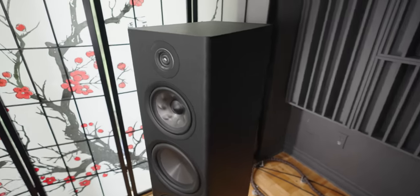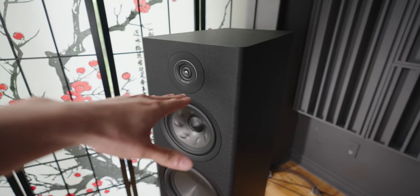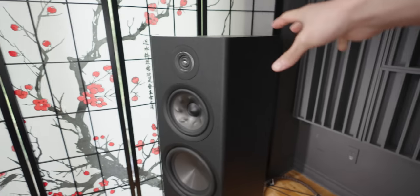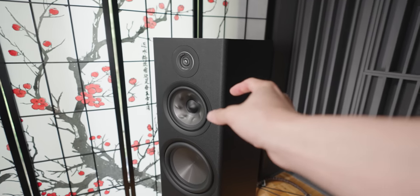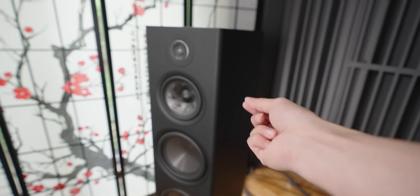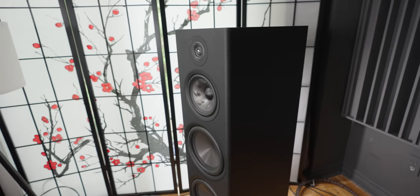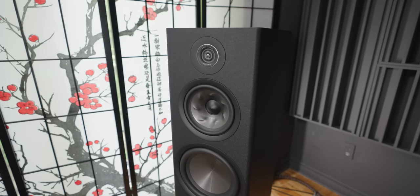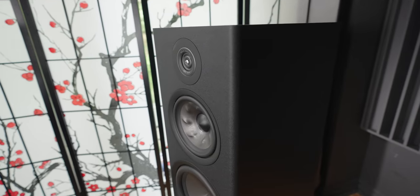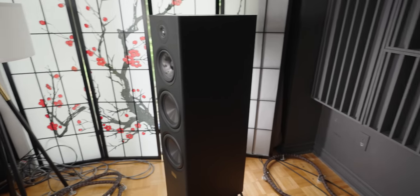In terms of placement, I like to have these speakers toed in towards me. If I have the choice, I like to sit right between the tweeter and the woofer - I found that to be a good axis point. And I like to have the speakers toed directly to my sitting spot because it gives better focus. Since this is a floor stander and not as pinpoint as the bookshelf, toeing it directly at you gives a little bit more focus. You do get more soundstage if you toe it out into the room, but I feel this speaker is a little compromised in the imaging department compared to bookshelf speakers, so toeing it in makes more sense. I've placed them close to the wall and far from the wall and they work both ways, though I do prefer them pulled out a bit for more depth of soundstage.